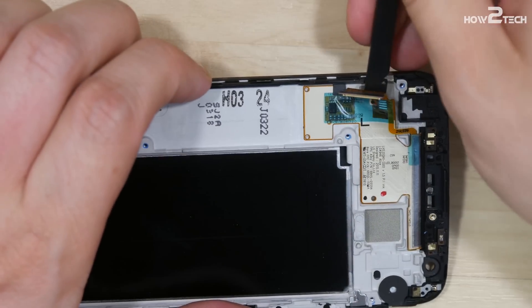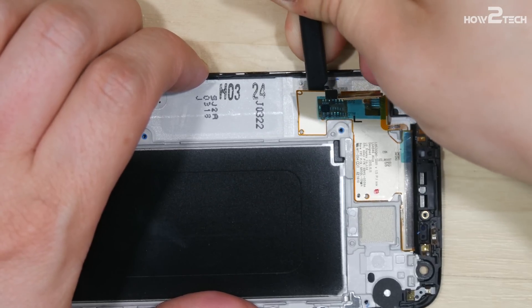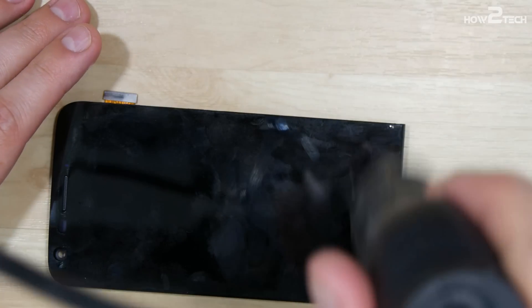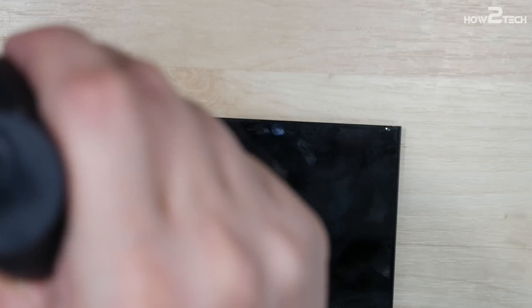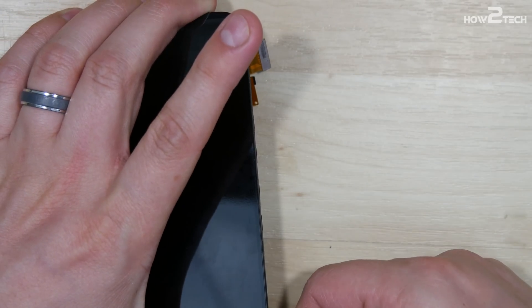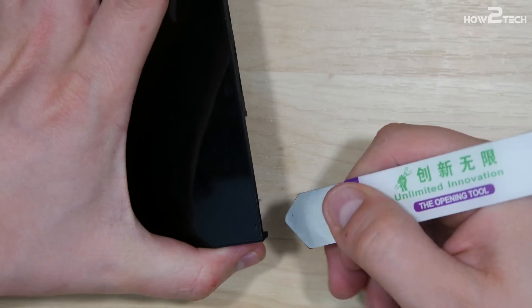Now that's done, we can go ahead and pull up the ribbon cable holding the display down. We want to move the display cable all the way up to the very top — make sure there's no adhesive holding it down. Now with that done, we can use our heat gun and go ahead and heat up the display — get it nice and warm. This is not using double-sided adhesive; this is actually using glue to hold this display in, the same type of glue they use on Motorola and iPhone displays to hold the plastic frame. It's really tricky to get into, so I'm going to try to use a guitar pick — but it's just a no-go. The only way to get into this is with an iSesamo tool.